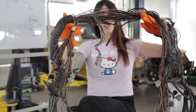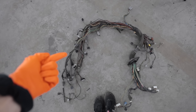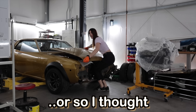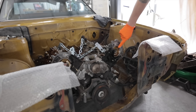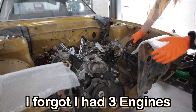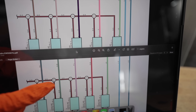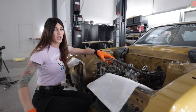Slight issue though — the harness in this Tupperware is actually the original harness off of my dad's truck and to that engine. This harness came from a 2004 Tundra, the 2UZ V8, whereas the engine behind me is my dad's engine and his truck is a 2005. The junkyard engine had VVTi, so it might have been a late '04, early '05. For the most part the harnesses are almost identical — there's just minor differences in the wire coloration going to each one of the igniters.